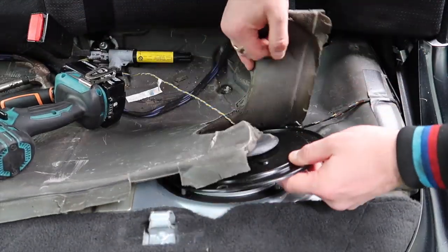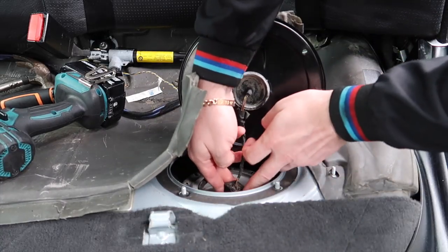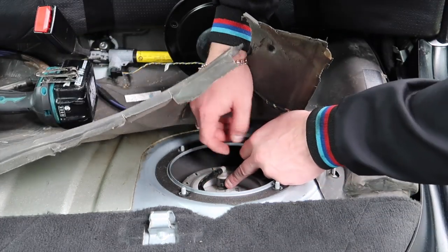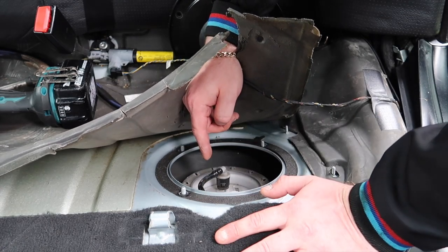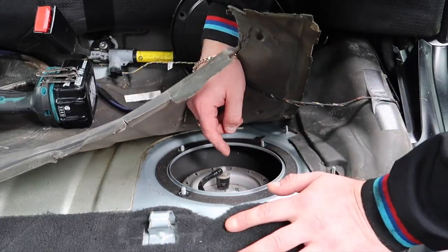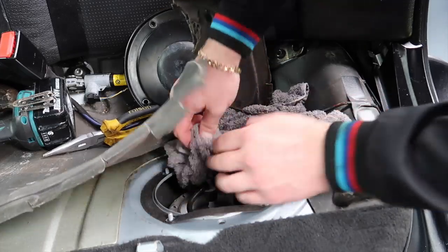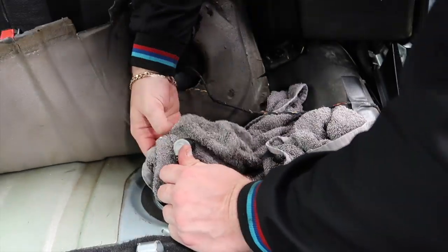The battery is disconnected — everything is released. Now we're going to move this connector, which should slide straight back off. Then we're going to get a towel because fuel is going to leak out, so we need to be prepared to capture that. I'm just going to get a cloth to capture all the fuel that comes out of the pipe when we remove it. Now we've got the hose off — it wasn't under much pressure.